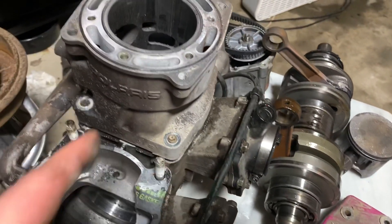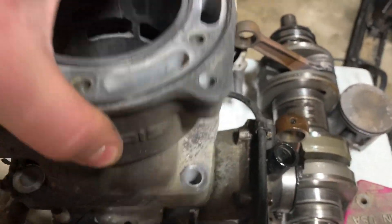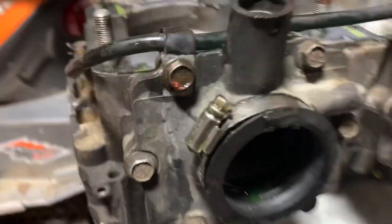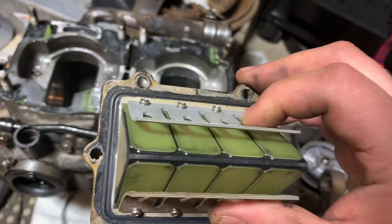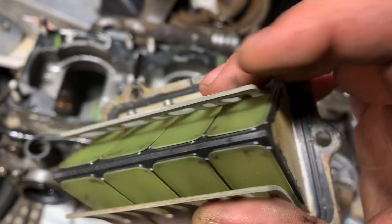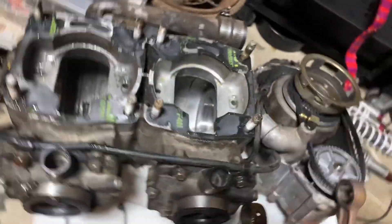Just think of it as a big vacuum — sucks air in, goes in here, gets compressed, ignited, blown out the exhaust. Pretty basic. The cylinders slide right off the cases — that is what a cylinder for a two-stroke 700 looks like. Over here you have your carb boots, and inside of there you have reeds, which look like this. That is your reed cage and reed petals. Generally you want them to sit nice and flat against the cage, not cracked, no edges broke off. This is a stock unit, not aftermarket.